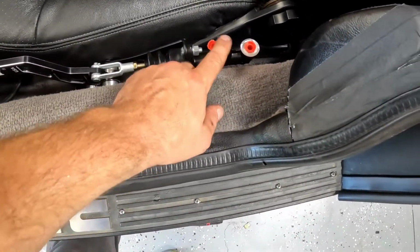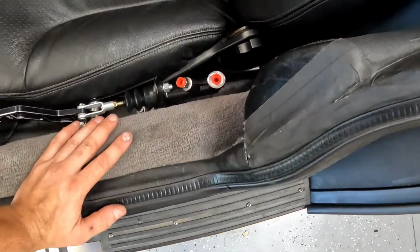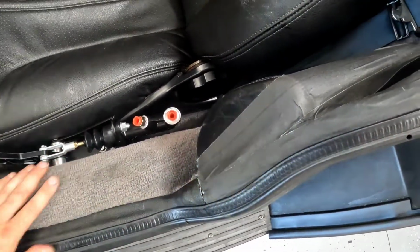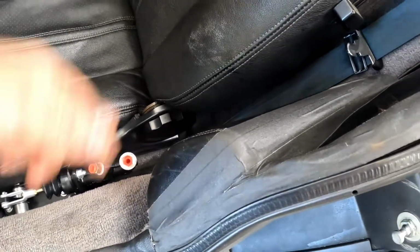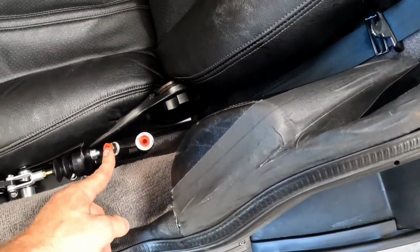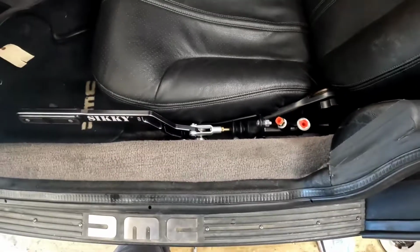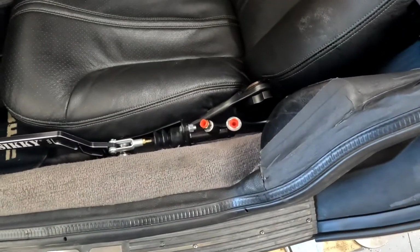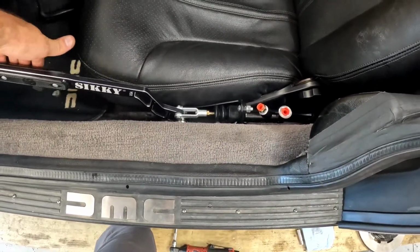Obviously this takes commitment because you're going to have exposed brake line cables here. I'm going to use the existing parking brake hole that was in the back of the car, and I'm just going to tie into the rear distribution block on the back of the frame. Basically the brake fluid's going to go to the back of the car like normal. Once it gets to that rear block on the back Y of the frame, it's going to come in here. This line's going to go back out and go direct to the brake calipers, and when I push the brake in the car, it's just going to travel through this master cylinder to the back brakes and work. And then when I just want to lock up the rear brakes, I'm just going to go like this. Skeet, skeet, skeet.